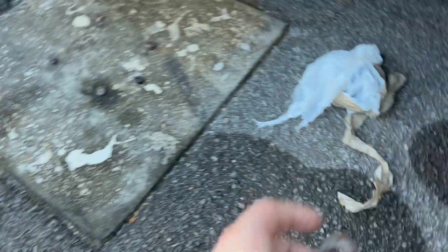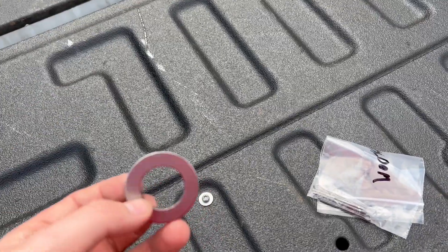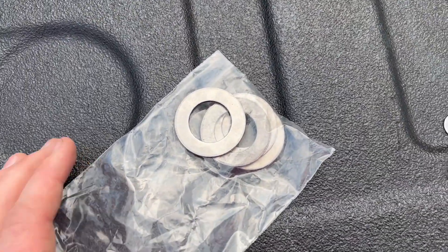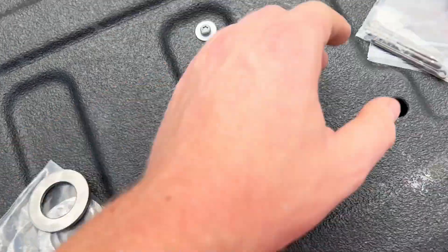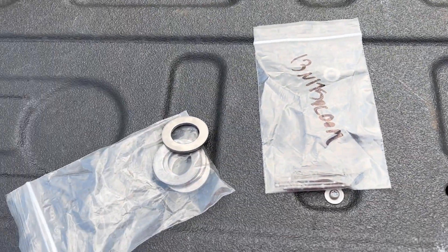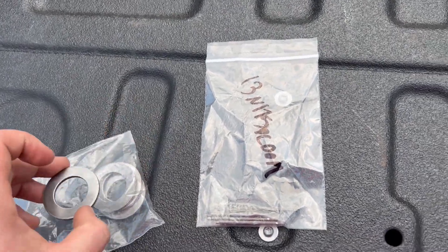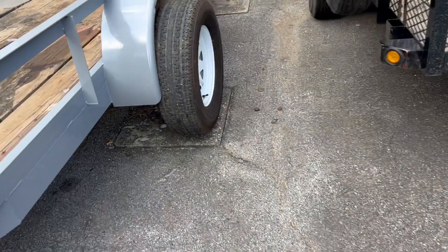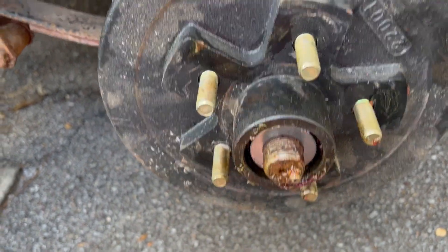Not a big deal. I also need to get new cotter pins because I couldn't find my big box of them. A week after that last clip, I finally got the correct washers. I ordered these from e-trailer because nobody locally had them — these are one-inch spindle washers, sized for the one-inch diameter spindle. I ordered four plus more cotter pins; cost plus shipping was $25, which is annoying but not too bad. That fits perfectly — let's get this thing put back together.